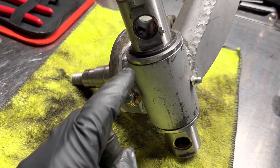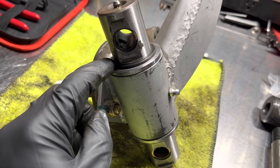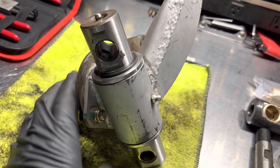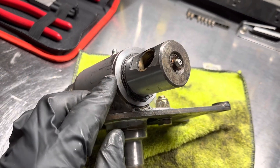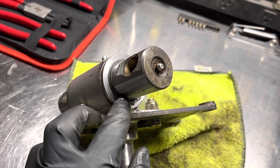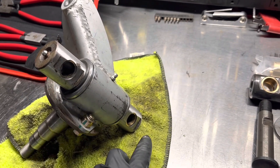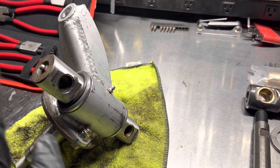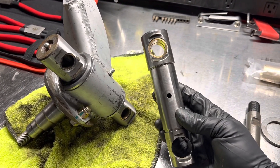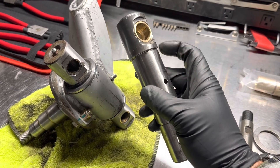The Tweed spindle design has the O-ring underneath, then a washer, then a larger snap ring on top that snaps into a groove in the kingpin. On the bottom there's an O-ring sealing out the needle bearings, a washer, and two snap rings. The key difference is that the Tweed kingpin is the same diameter from top to bottom — inch and a half all the way — so it can slide through from either direction. The Fodral kingpin has a larger section on top, so it sits down from the top and you don't need a snap ring on top, just a washer and O-ring.